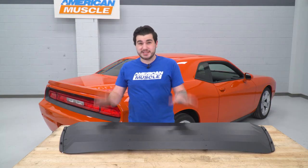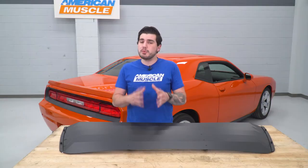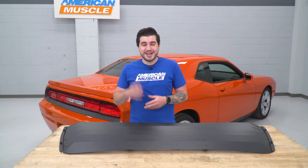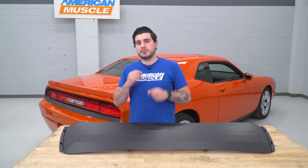That's pretty much what the assembly looks like. Now head over to your back windshield, grab some soap and water, and clean off the windshield completely using a microfiber. It's not recommended to use something like Windex because while it does clean the windshield visually, it leaves chemical residue which can prohibit the bond between the 3M and the glass. Soap and water is your best option. You can also use the adhesion promoter included in the kit — it's a small packet with a wet sponge — and apply it to the windshield before putting your louvers on to help promote adhesion.